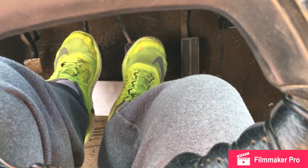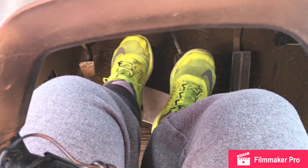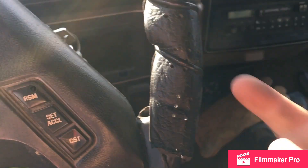The way I see it is that pushing the clutch in totally disengages it from the engine. As you kind of ease on it, you're going slow - right there is when it grabs. It grabs more and more, so you start off slow and then go faster until it's fully engaged. Since it has a fuel leak, you have to give it a little bit of gas too. Before you want to shift, you want to fully depress the clutch, shift down, then give it some more gas - let off, then give more gas. That's how it's working for me.